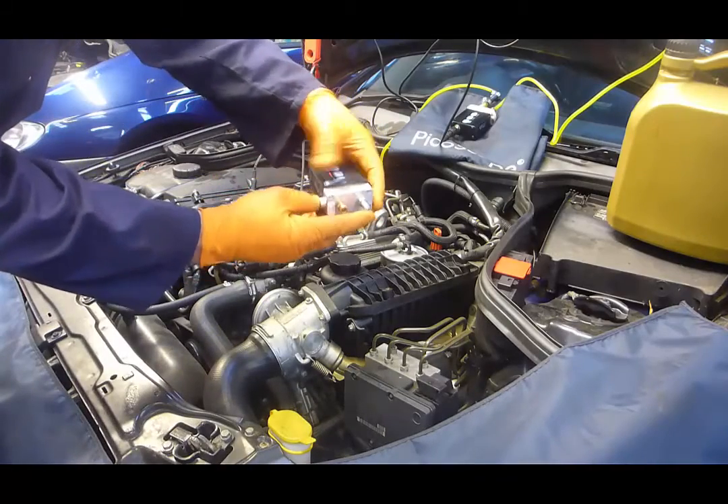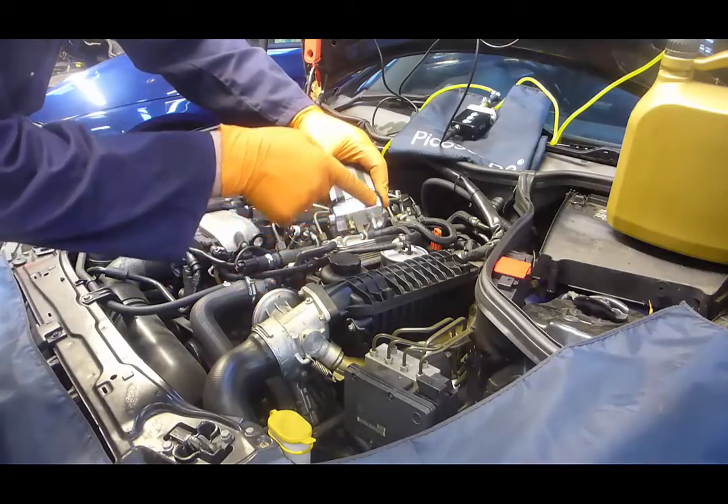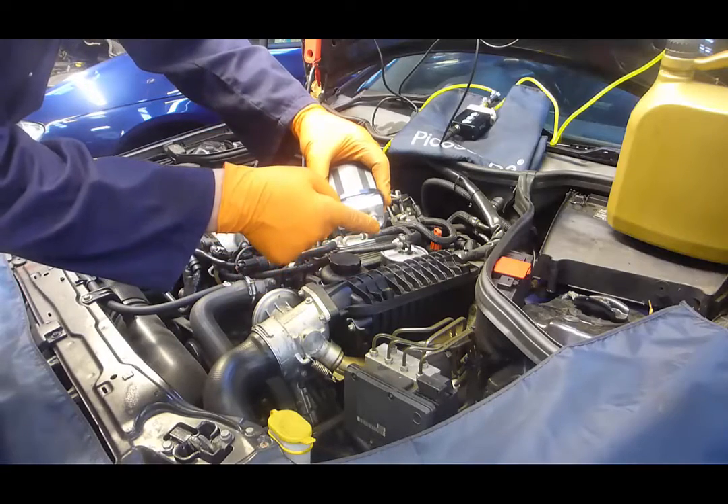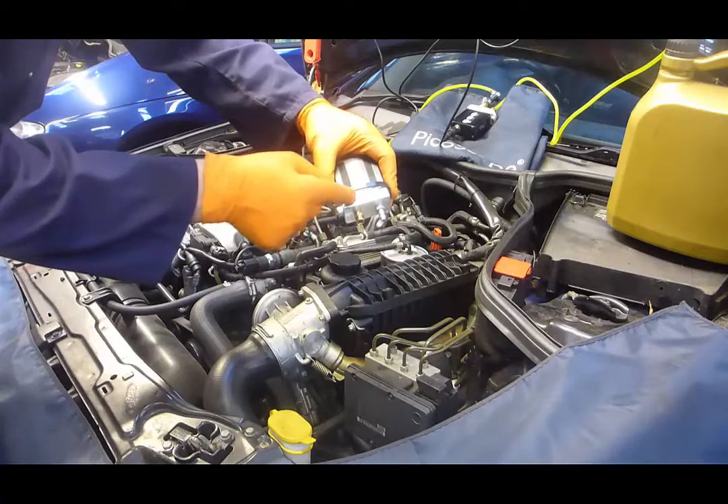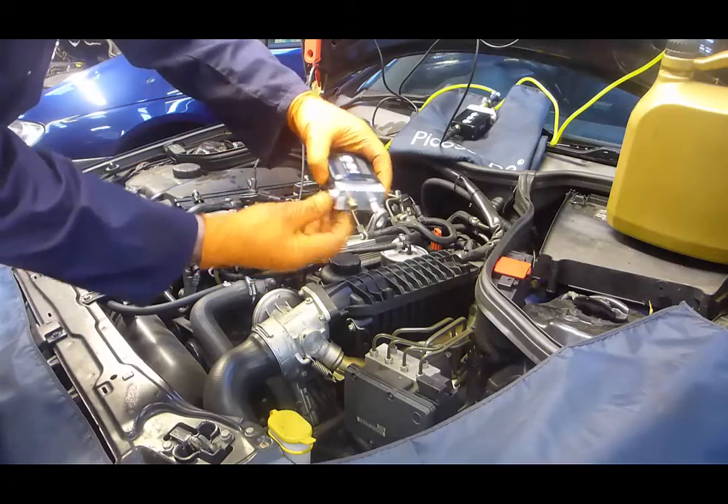Because we're measuring spill, we're going to be measuring spill or back leakage through the measurement port, through the measurement chamber. It's important that we don't offer a restriction here, so we must have a flow through and straight back out.